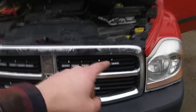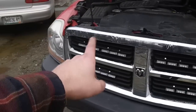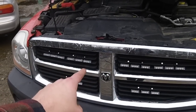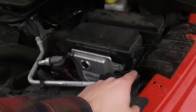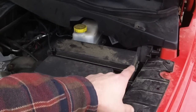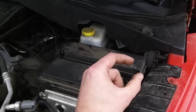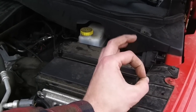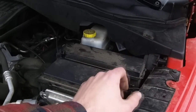Unfortunately, on this really large SUV, going from here all the way back into the cab and up to the dash was just plain too far for this series of lights over here. So I ended up having to solder on about a foot and a half of extra wiring for each of these, and now it goes across, comes up over this area here, drops down in, and goes through a handmade grommet. For those who don't know how to make your own grommets, it's easy enough — just drill your hole through, cut off a piece of rubber hose about that long, cut down one side of the edge, and then clamp that around your wiring as it goes through the steel. Slide it up and apply RTV sealant around the outside — makes your own custom grommet.